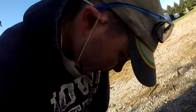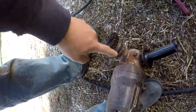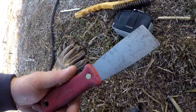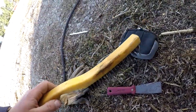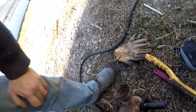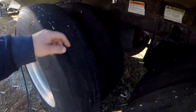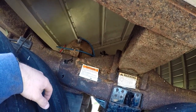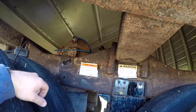Got my safety squints and mask ready to go. Weapons of choice — we're going to be using this angle grinder from back when Craftsman was actually good quality. So basically going to use this on the big surfaces. Gloves to kind of keep my hands from getting any more dirty than they are. Putty knife to scrape off any seam sealer that isn't stuck anymore or flaky rust back in corners and stuff, and then a hand wire brush to kind of get spots that I can't get to with the grinder. So we've got the power cord strung out for the grinder. I went ahead and strung out the air hose as well because I'm probably going to want to blow some stuff off at some point. And the next step is to crawl up inside here and kind of work from the top to the bottom.